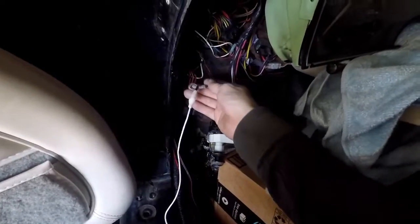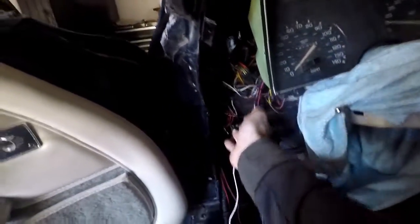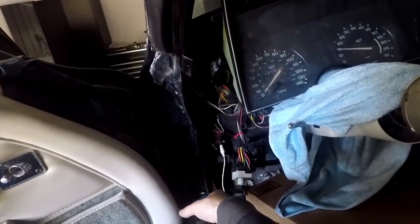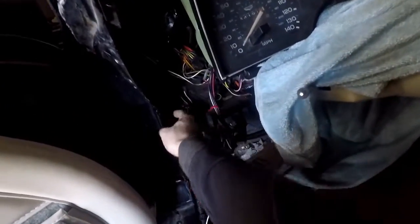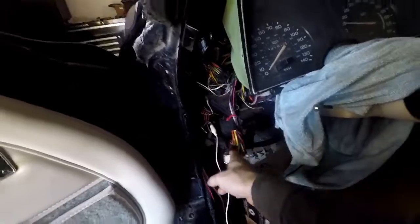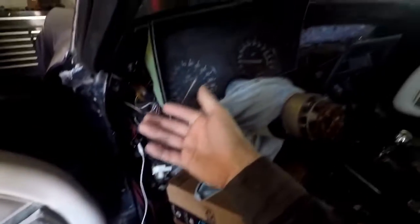This ground over here is the ground for your dash gauges. Now because I did pour on the birdcage area, my ground doesn't exist anymore — I'm going to need to sand off a spot and place it back on. But that's what I was doing temporarily: just jumping from there to the seat bolt down here to give me the ground so the gauges would work.